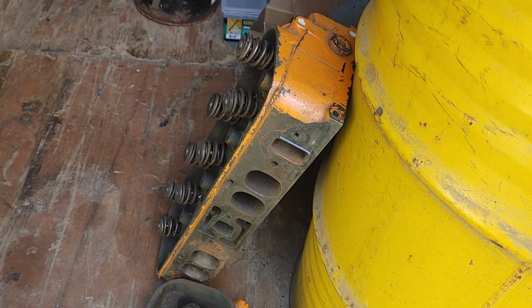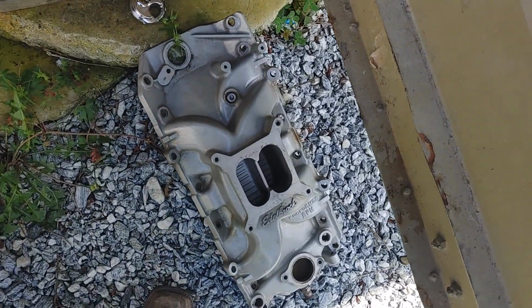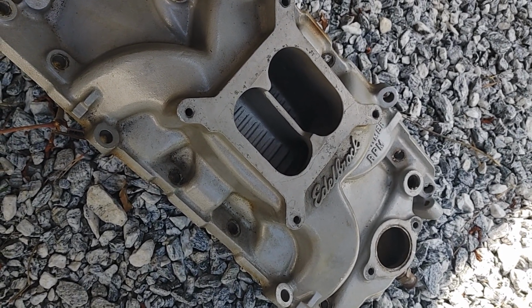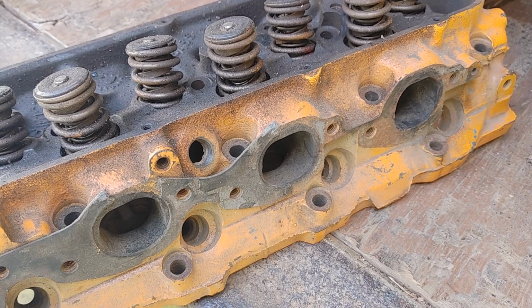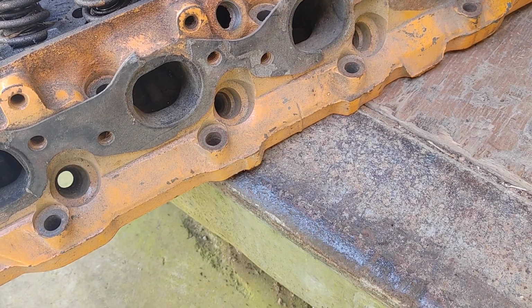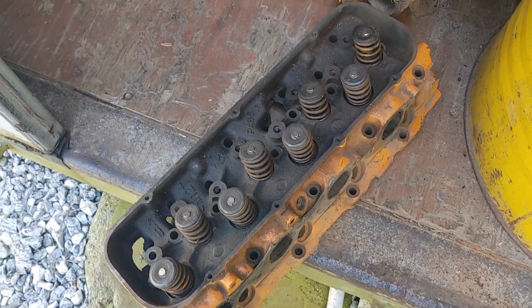And anyway, like I said, I was making this video for a new subscriber there, to let them know I know a little bit about what I'm talking about on these big blocks. So if you're watching this video, fella, you can put that Chinese intake on there if you want to, on them peanut port heads, but I think you're going to waste your time. I would just get me a set of 049 heads and put some 2.19 intake, 1.88 exhaust valves, mill them, and run a 240 to 250 duration cam at 50 thousandths and .600 lift, and you'll be all right, man.